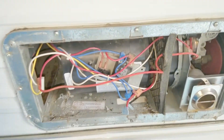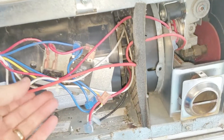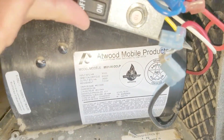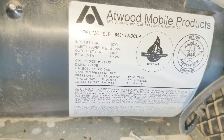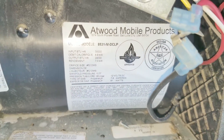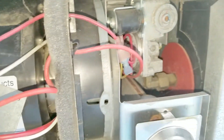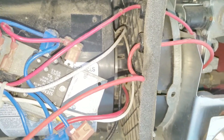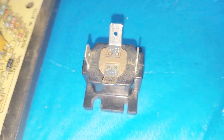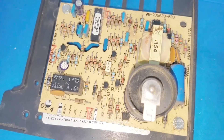Today we're going to work on the heating system for our camper. This is an older unit, the Atwood 8531-4 dash DCLP. The problem is the time delay switch — which is over here — is either broken or the circuit board is broken.